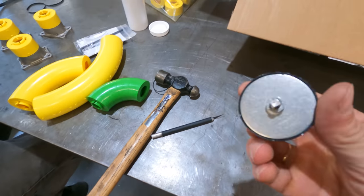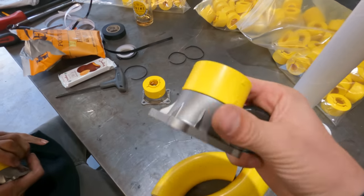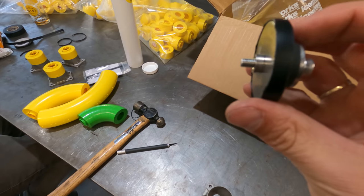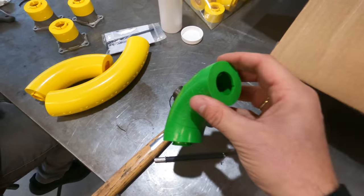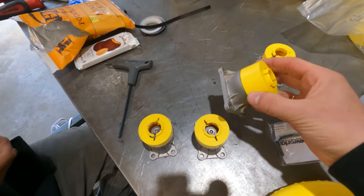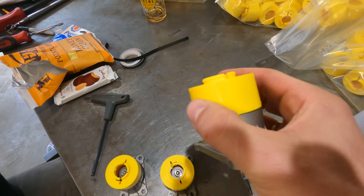So this is the plug that goes into the header flange. And this is what holds the caps, or I guess the first piece into the header flange that you can build off of. So it's basically pretty traditional design here. It's just some rubber smushed together that expands to hold inside when you crank this down. And then the ICE Engineering plastic piece slides right onto the top of here, and that's how you start the project. So we already have our modeling block adapters into the header flange, and we install the first blocks onto the block adapter. And this is the start of the header design.